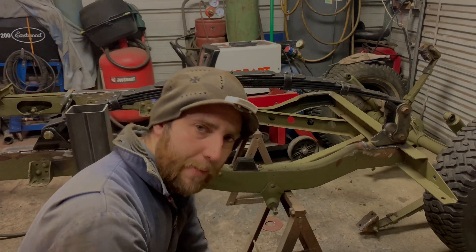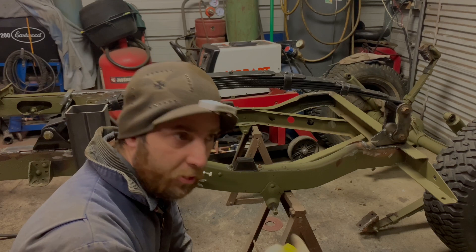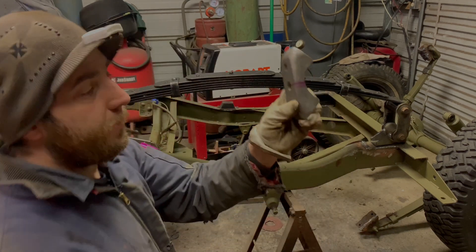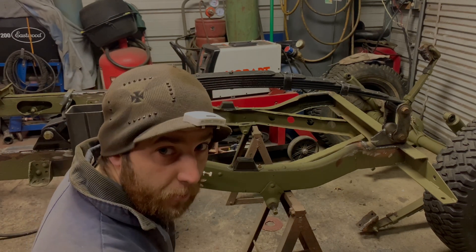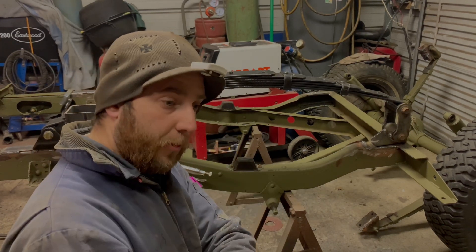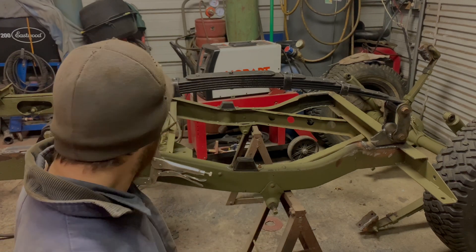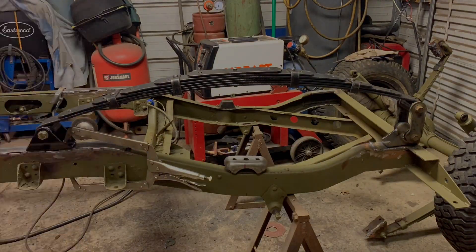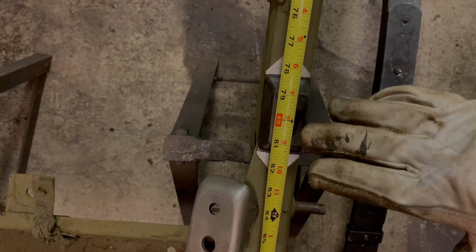That was incredibly hard — a lot of math involved — because I'm trying to get the 80-inch wheelbase right in the middle of the tub with my size tire. The frame's upside down, and I have it marked on my new weld-on spring mount for the axle. Everything came up really good. I triple-checked it and we are right on the money for an 80-inch wheelbase — that's literally perfect.